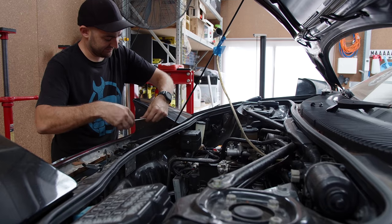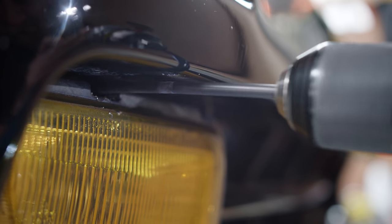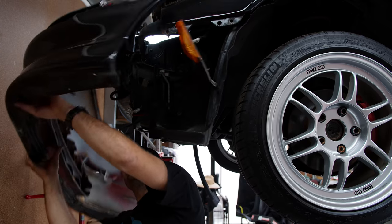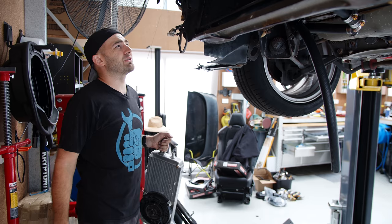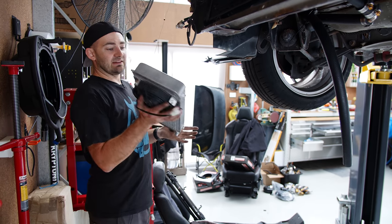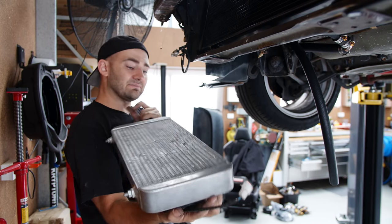With the pump mounted, next I need to install the water-to-air radiator. The front bumper has to come off as it can only go in from underneath. Then I need to sneak some bent up hard pipe in front of the engine coolant radiator to make it all work. Of course the bumper is full of rusted out fasteners so getting it off is a total pain. I've had a monumental fight with that front bumper bar — I cannot believe how hard this car fights back. Just where the bolts are, it wants you to take the headlights out, which in a normal car is a couple of bolts, but these are a little bit more complicated being big flippy-uppy ones. Usually that's what gets you in trouble when you're trying to avoid doing the obvious. Anyway, it's off. The next step is to put the heat exchanger in here. I'm going to leave the fan on if possible. One of the horns isn't connected and hasn't been for a long time, so I'm going to get rid of it — it should buy me enough space. Sit it hard against the radiator, mount it, plumb it, bump it back on.